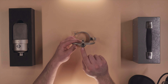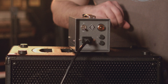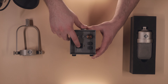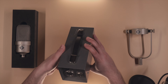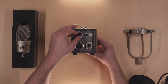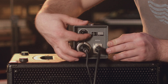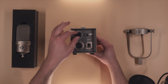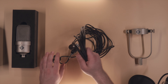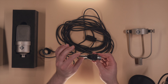The yoke mount simply mounts onto your microphone stand. Next up we have the power supply, featuring a very satisfying switch with a beautiful bulb, two fuses, an IEC inlet, and it can be switched from 100–120 volts or 220–240 volts at 50 or 60 Hz. On the other side we have the microphone input and the XLR output. What makes this so special is completely variable polar patterns all the way from omni to figure-of-eight and everything in between. When changing polar patterns, make sure the microphone is muted in case of very low frequency rumbles that might hurt your speakers. I like that Neumann have now included a velcro cable tie — it's a nice touch. The connections feel very solid and premium, and I like the little see-through plastic to ensure there's never a heavy angle on the connector.